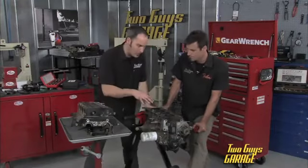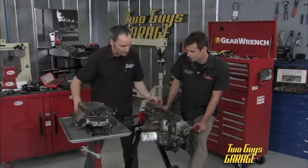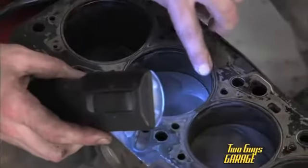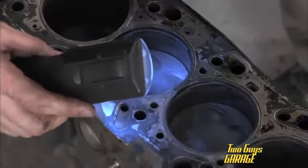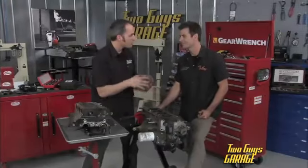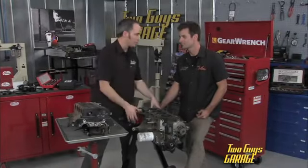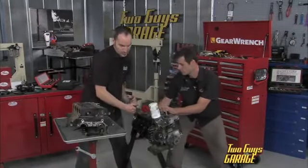Another thing is you've gotten this so hot, and these pistons get soft, and they'll start scuffing, leaving material. So look in your cylinder bores and see if you've got any metal transfer from your piston onto your cylinder walls. This doesn't look too bad. The timing system went quick and saved a lot of real big damage, but there's a lot of hurt still on here. Maybe we should look under the bottom. Oops, the other way. And check out some of these bearings.